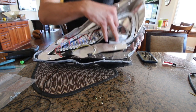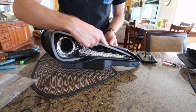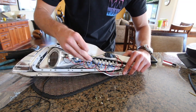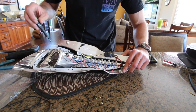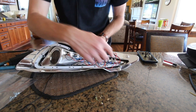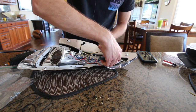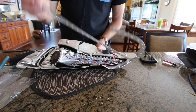Now we can separate this part and put the lens away. The next step is to remove the clear boomerang by removing three Phillips head screws that hold it in on the other side — one right here, one right here, and one right here. Before we remove the light we're going to unclip it from the wire harness, so we'll take our wire cutters and clip both the black and red wires leading to the boomerang.